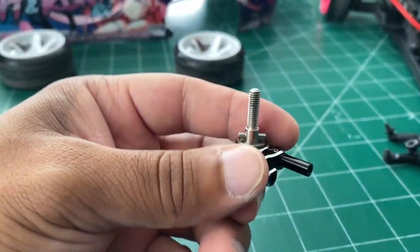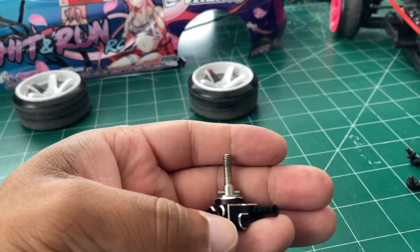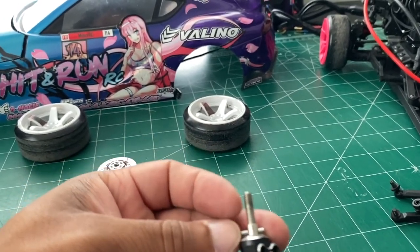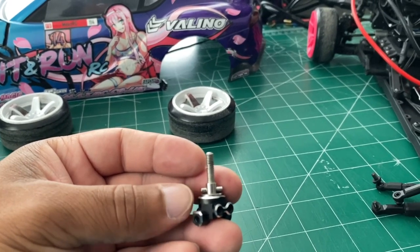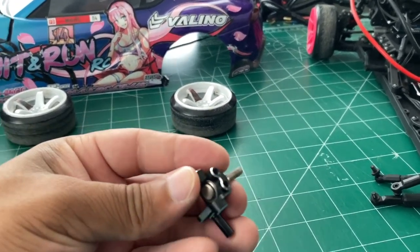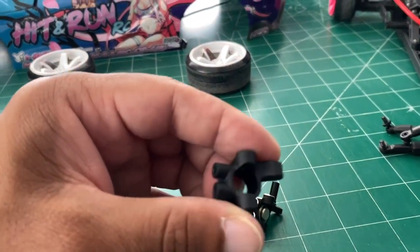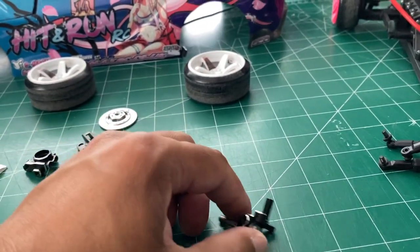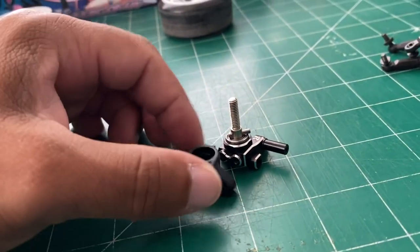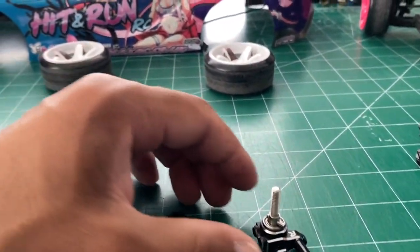I got my knuckle fully assembled. See how the bearing sticks out a little bit — you might think you're wrong but that's actually where it is. The pin is exactly where it needs to be. If the bearing were supposed to go all the way down, there'd be too much of a gap between the pin and the bearing. You can look inside and the space is exactly the same as the original, but there's less material on the aluminum than on the plastic, so the bearing is meant to stick out like that.